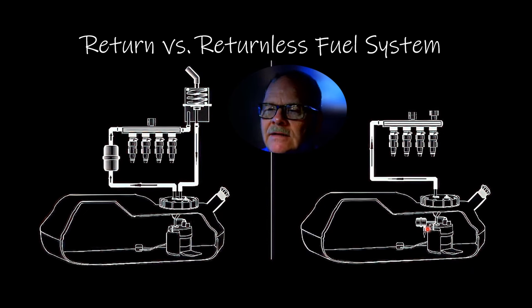Now, the returnless system has a regulator — usually right on the fuel pump in the tank. Honda does this even on the ones that feed high-pressure GDI fuel pumps. Cadillac does this even in the late 2000s. Chrysler was doing this in the mid-'90s. The crazy thing about the Chrysler stuff is I worked on a Dodge that had a misfire on cylinder number one. It drove me crazy until I realized the fuel pump was cavitating — the engine was sitting at a slight angle with the front up, and the highest part of the fuel rail was where the number-one injector was. Bubbles coming out of the fuel pump were going to the top of that rail, and since it wasn't a return system, that air couldn't go anywhere. You always had air instead of fuel at that number-one injector, causing the misfire. I thought I was going to go wacky trying to figure that one out.